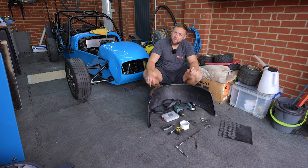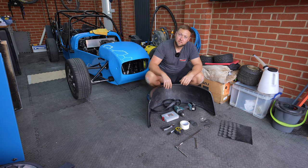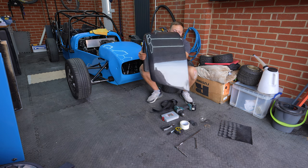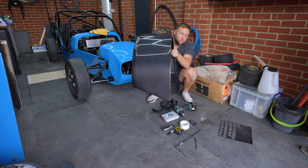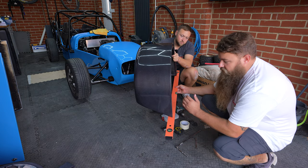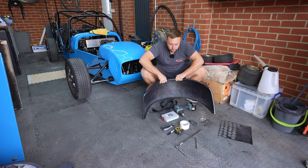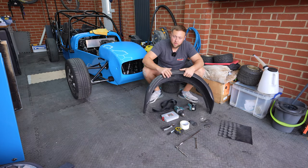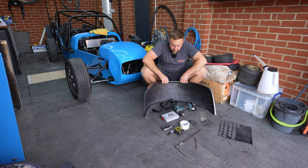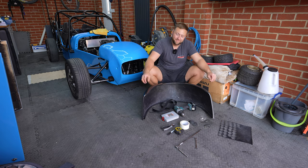And a bit of wood or trim, because what you can do is hold it underneath. If you were to put a bit of something across - using Rob's spirit level as an idea - basically bolt that to the bottom of the car so you can rest the arch onto it. Then it allows you to take your hands free, because obviously we're lucky we work as two. You might only work as one.